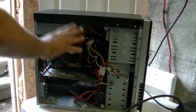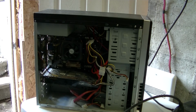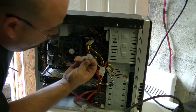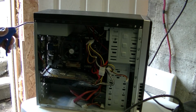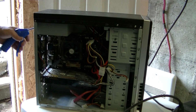Now we're going to tackle the main computer parts. One of the big things I always do is not tackle the inside right away. I tackle the power supply first, because the power supply also has a bit of dust itself. I see here there is an intake grill that's full of dust, believe it or not. And there's the exhaust. So we want to go with our little nozzle into the fan grill and make sure it clears the fan blades.